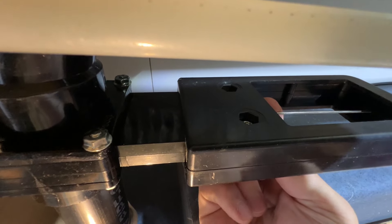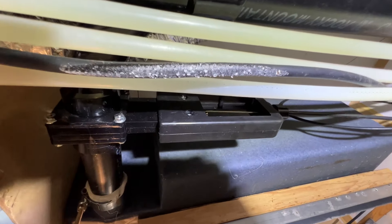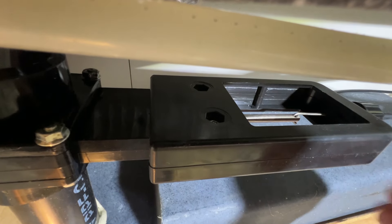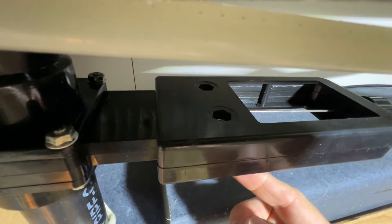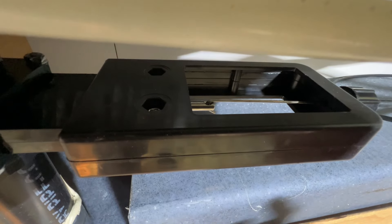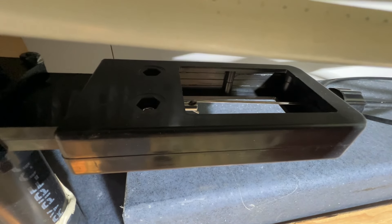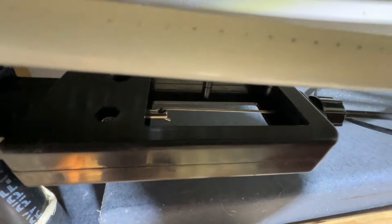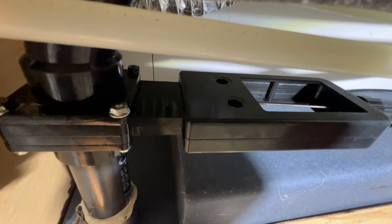The tank is empty right now. Carla is over there — she's going to pull out the gray valve. Yeah, it's going out. Now push it in — all the way in. Okay, the handle is all the way in but the valve is not actually all the way closed. If I push on it, there's just a little bit more — there's probably a quarter inch of valve that is not closing all the way. So I'm going to have to look and see if I can adjust it or if we need to replace it.